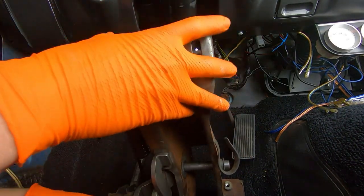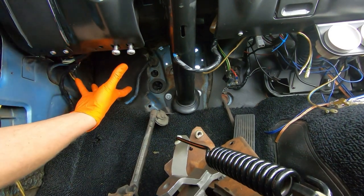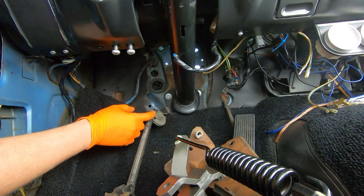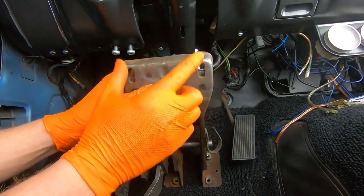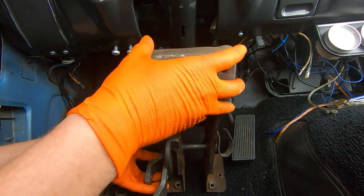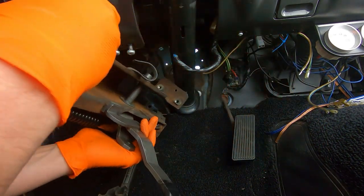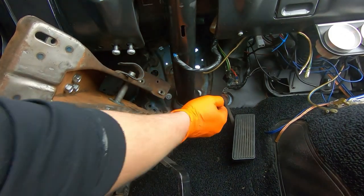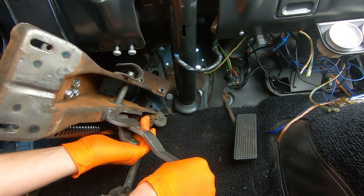Just a brief recap: in order to get your support out of the car, we did take the fresh air vent out, lowered the park brake lever assembly, and this just unbolts from the firewall. The front mount — these two bolts in the front are also the column support — those two drop out and then you can remove your pedal support. Getting it back in, we're going to slide it in on this side, then work our brake pedal into place, since the brake pedal will be on the right-hand side of the column.